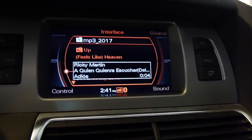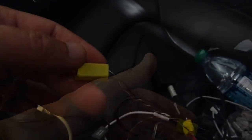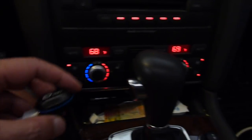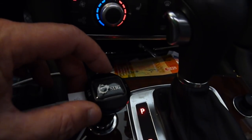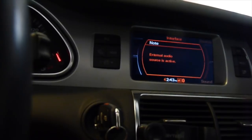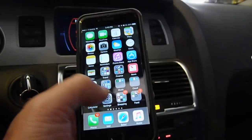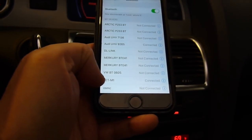How do I change this so that it's on the fly? I hooked up an electronic relay. This relay is set up so that every time I plug in the USB for my dongle Bluetooth, it will automatically turn into auxiliary and I can play music from the phone. So just say my daughter wants to stream her music — she doesn't like what's playing — all she has to do is plug it in. Audio source is active. And I go to Settings, look at Bluetooth — I should see my Bluetooth is connected with the player.